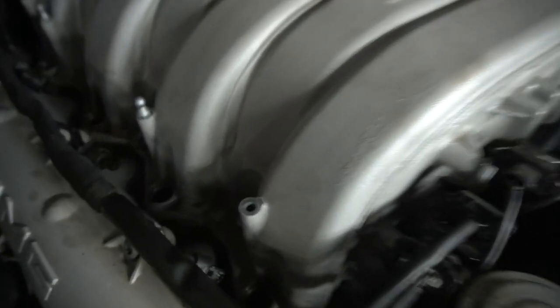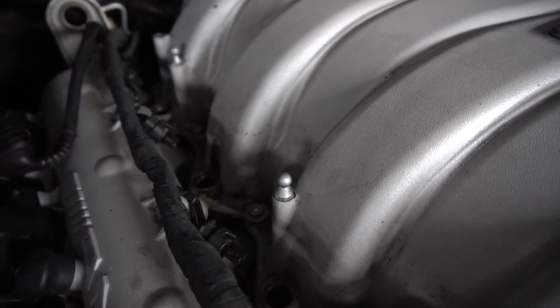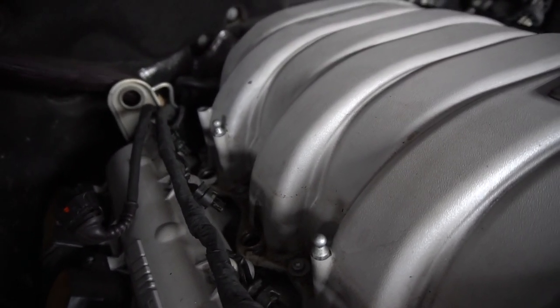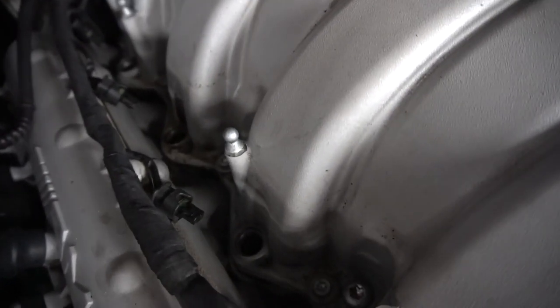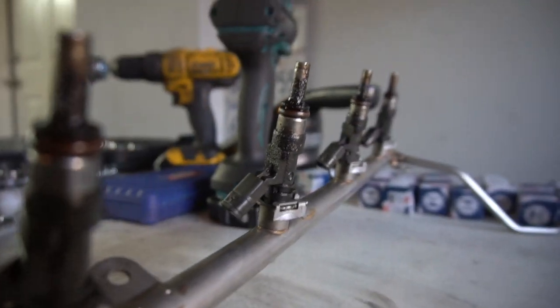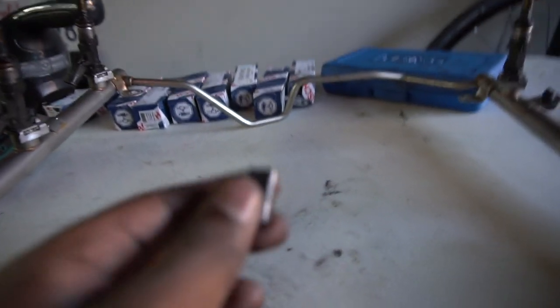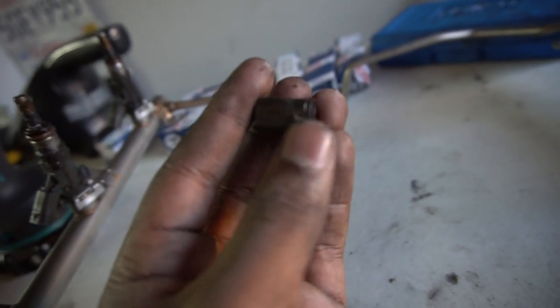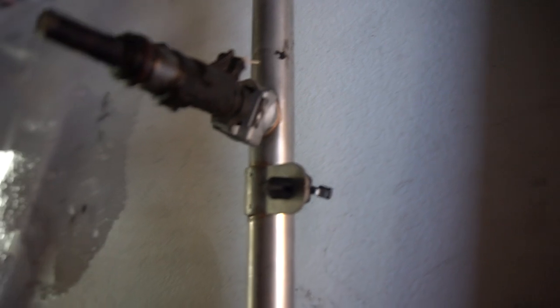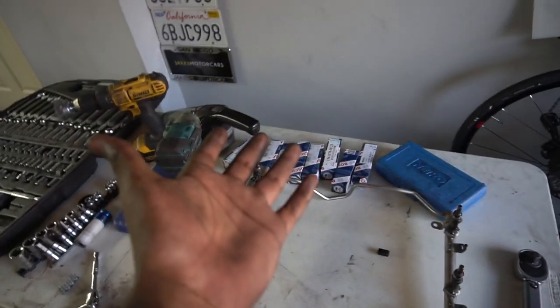With the injectors out, it is pretty gummed up in there — a lot of oil just sitting around. I'm wondering if it's all from the intake manifold, built up from poor crankcase ventilation. I think I need to change out the PCV valve and put a catch can in soon, and I've got to clean out these injector ports as they are filthy. I'm actually shocked at how dirty these injectors are at 85,000 miles — a good amount of carbon built up on them, and the plastic itself is degraded. In fact, one of the injector connectors just broke off without me putting any force on it at all — it was already cracked. I'm very glad I'm replacing these; they are definitely due.